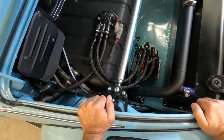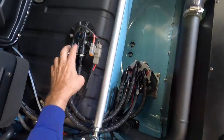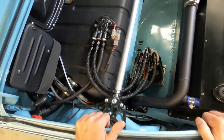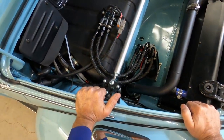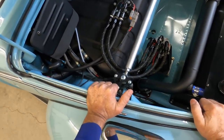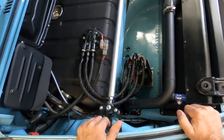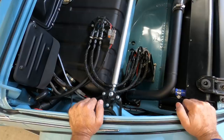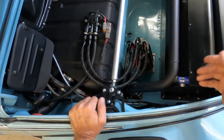And that worked fine. The second fuel pump works off a Hobbs switch, which is pressure activated on the intake manifold. So I have it set at 14 pounds. So at 14 pounds boost, the second fuel pump kicks in. So that way, both fuel pumps aren't always running all the time, which saves on electricity, heats the gas up less, etc.